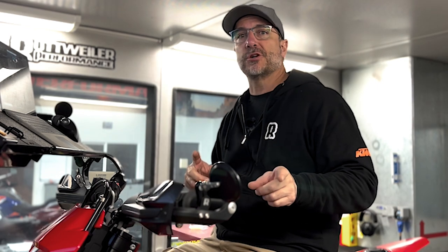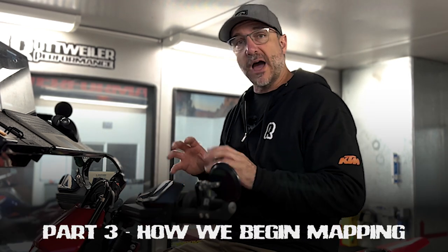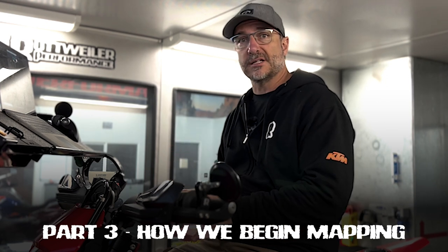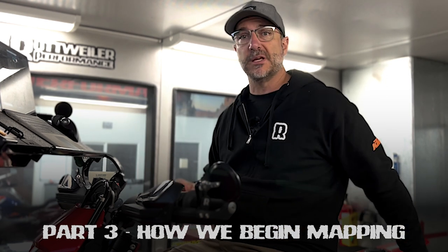All right, now we're going to show you how we begin the mapping. So we've got an exhaust system on here uncorked, and we have our Rottweiler intake system bolted on as well. So we've opened up the exhaust, we've opened up the intake, and now we put a Power Commander 6 on, and we're going to begin our mapping. And typically what we'll do is we'll start with a map that we feel is as close as we can get, which is obviously going to be something from the 690 or 701.